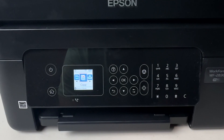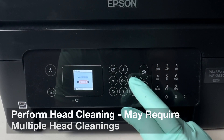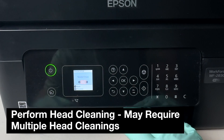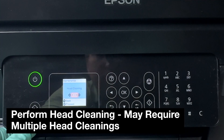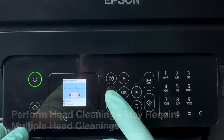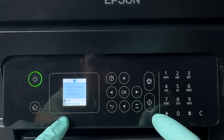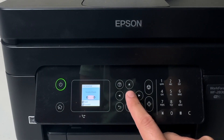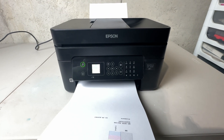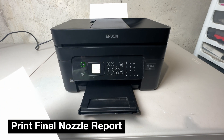We are not done with this cleaning. Go back into the printer settings, click on maintenance, and find the section where you can do a print head cleaning. Here it is — head cleaning — it is under maintenance. Now this is different from what we just did. The purpose of the head cleaning is to actually push ink back into the system. It does a cleaning by doing that, and that's exactly what we need after we've done the manual cleaning with the cleaning kit.